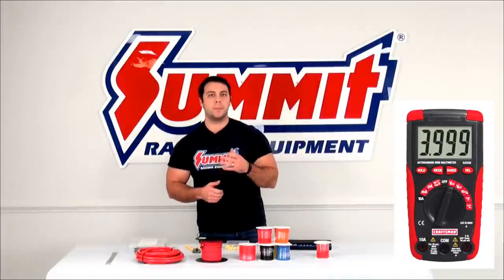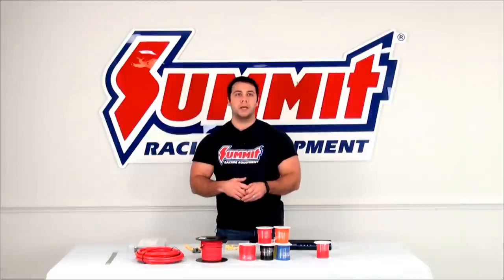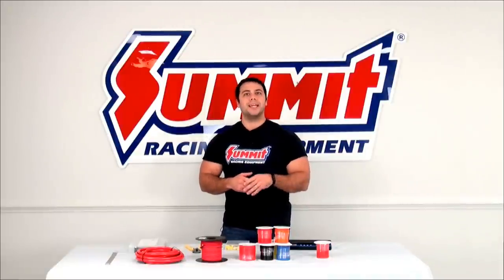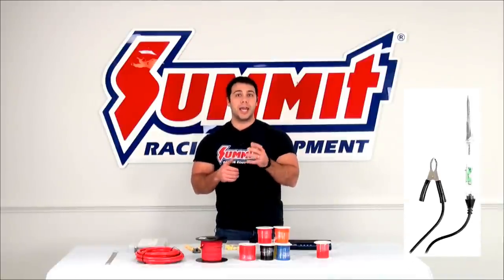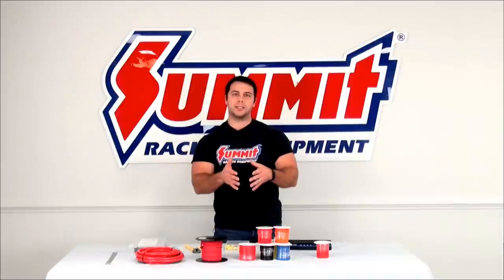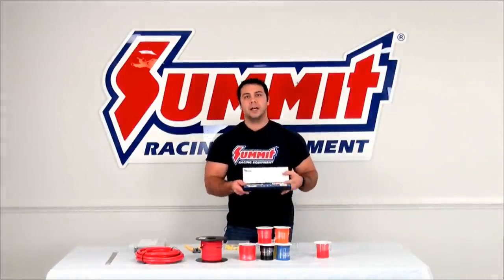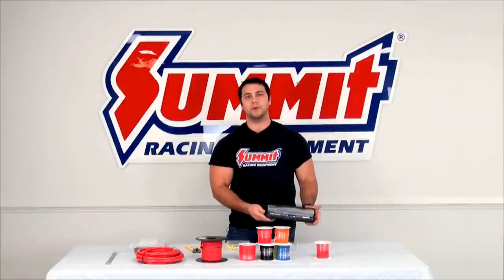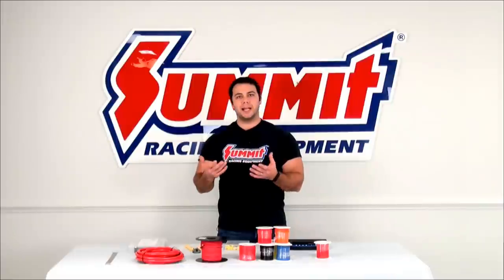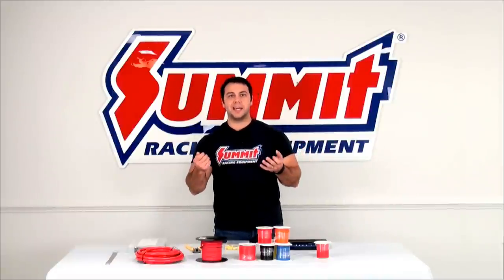One of the first things I'm going to mention is a multimeter. You want to have a good multimeter so that way you know what kind of amperage and volts are flowing through your system at different times — it's easy to use to test your battery. Another thing you may want to pick up is a 12-volt test light, because sometimes you just need to make sure you have 12 volts at a given point, and it helps you start to diagnose issues and chase electrical gremlins back through your system. Another thing you may want to look into is a good soldering iron. Here I have the PowerProbe soldering iron — it's a gas-powered soldering iron. I like to use it because it makes it a little bit easier when you're crawling up underneath the dash to connect some wires, since you're not carrying along an additional cord that gets tangled in your feet.